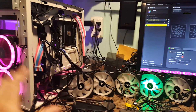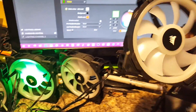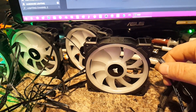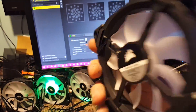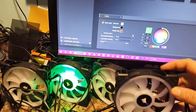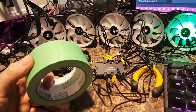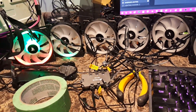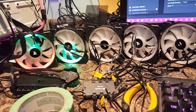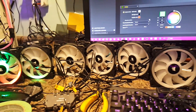That way you know which direction you need to go, where the fans need to be oriented. On the tops of these fans — let's flip this around — you can see the label right there, the Corsair label up, and the wire off to the right. So, always remember that: Corsair label up, wire off to the right. On the top there should be some arrows, and this will, of course, show you the fan direction and will help you out with your orientation. If you need to, take yourself some masking tape or painter's tape, just some kind of tape that you can write on, and get yourself an ink pen or a sharpie or whatever. Mark them individually if you need to — put a little mark on there so you know where your top and bottom are going to be.